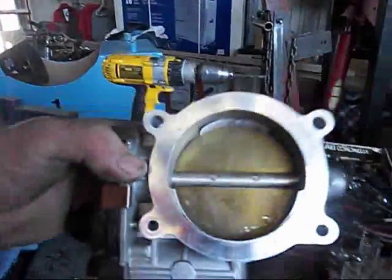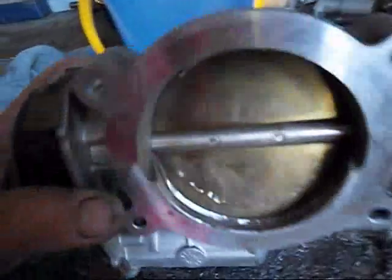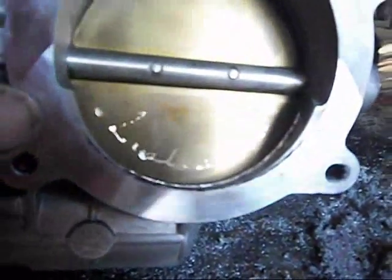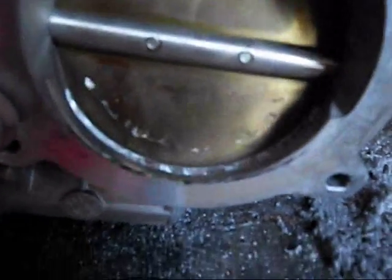Now I just finished grooving that throttle body and I want to show you where I started, where I finished, and what it looks like. There is the throttle body. We start at the far left over here and we do a little scoop, a little scallop every time. This one's done by the master, of course, but as you can see there's still some scalloping and that's okay — I don't worry about that at all. You can see where the bit actually brushed up against the top part of the throttle plate. That's the starting point.